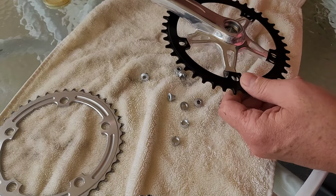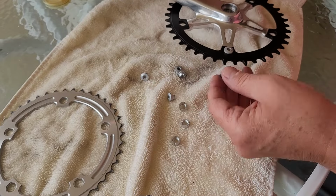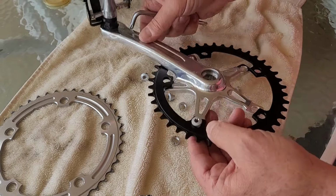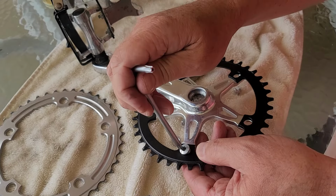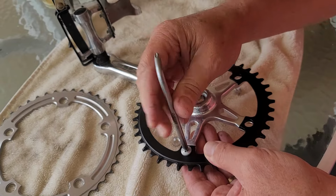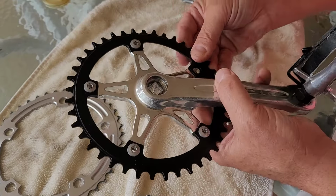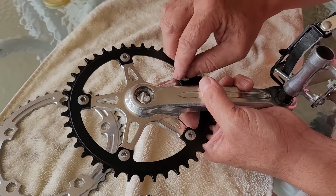The chain ring's pretty cheap too. I don't know, about 15 bucks on Amazon. There's a link in the description on where I got it. You know, there are different chain ring sizes. This is a 130 with 5 bolts. There's 4 bolts that are 110, and there are also, I don't know, several others.